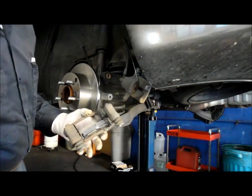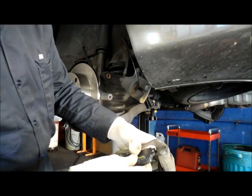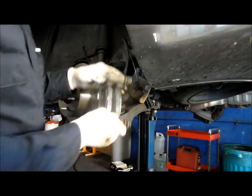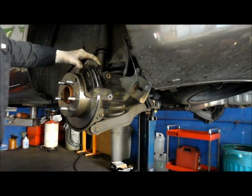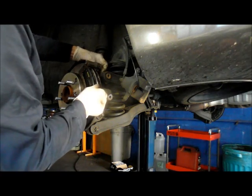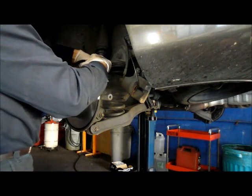On the outer one, you can put the brake pad in. Now you have lubricant on there, so it slides a little bit easier. Now we're going to reattach the mounting bracket back onto the car. We're going to reuse the bolts that we previously took out. You're going to catch them by hand, and then later on we're going to follow up with the ratchet.